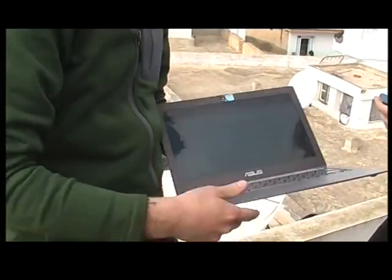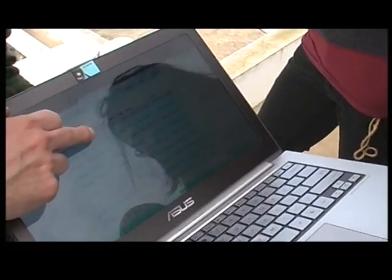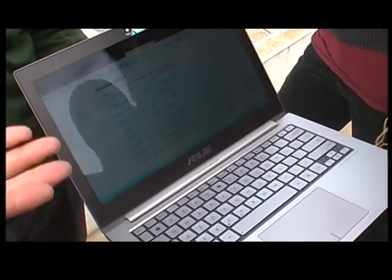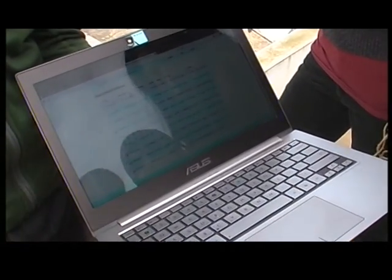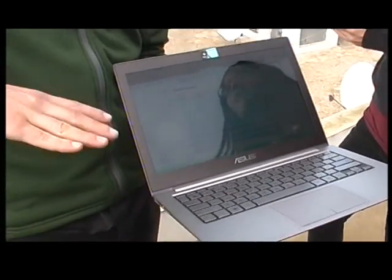We'll look at it even though it won't update, but we want these numbers to be high. They start as very large negative numbers and then they'll go up. The good connections are above negative 70, so negative 70, negative 65, negative 60, negative 55. That is a good range of signal, and so we can find the spot where those signals are the strongest, and then mount the router there.